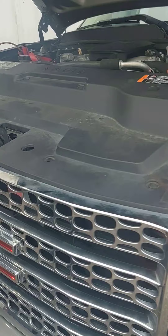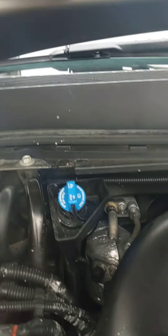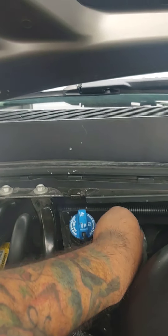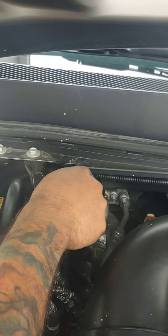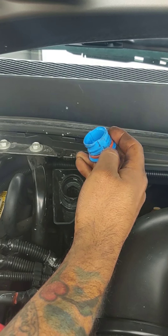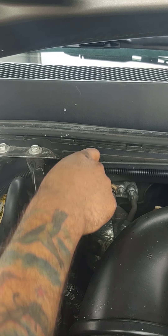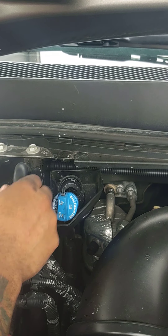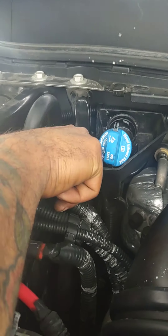One of the first things that I do — these break all the time against the firewall. We've done a lot. So first thing you do is pop your lid open. Make sure your rubber seal here is good, nice and intact, nice and fully closed — before you pressurize the system. Check this hose right here, up on the rear side.